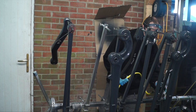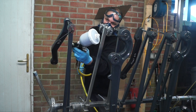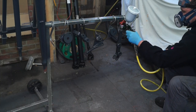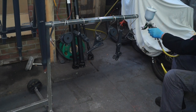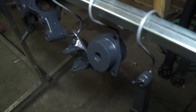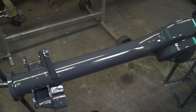This paint lays on very thickly and gives a very good coat. I'm using a 2mm spray nozzle fluid tip on the spray gun, which worked out very sufficient for the job. The frame I'm using is fairly rigid but a little awkward to get to all the components. I didn't like hanging stuff but had no other option — as you spray it moves about, but it was the only alternative to get everything hung and sprayed. The finish on these components is fairly satisfactory — a good thing with chassis components is that people will not see your mistakes.